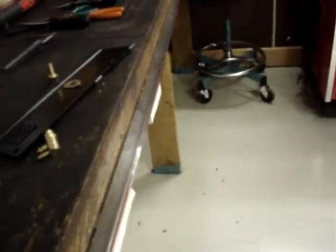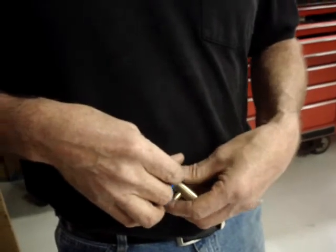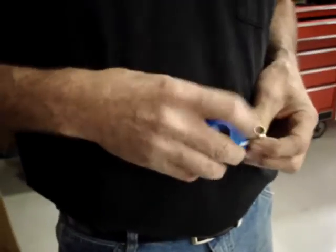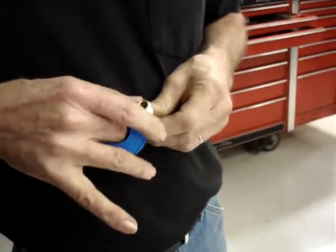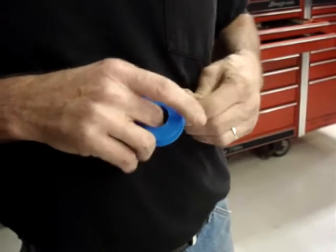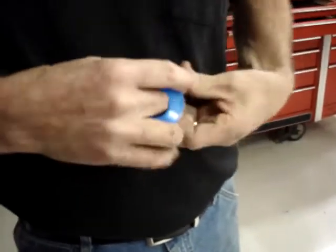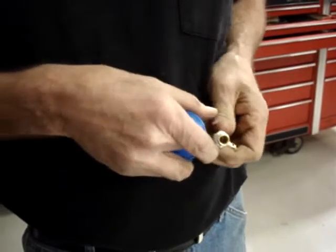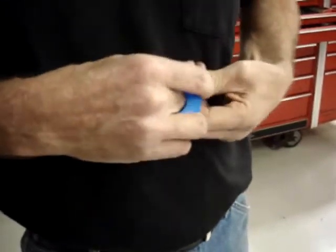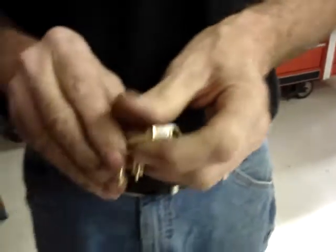So included in the kit is a roll of Teflon tape. Take the Teflon tape and wrap it around the threads of the quick disconnect fitting, being careful not to overlap the end, because if you overlap the end, you create a small piece of tape that can easily be torn loose and get lodged somewhere in the fuel system. And by somewhere, with my luck, that usually means wherever it will do the most harm. But wrap several layers of the Teflon tape around the threads. By that I mean at least three layers.